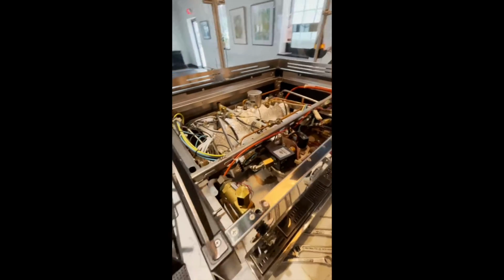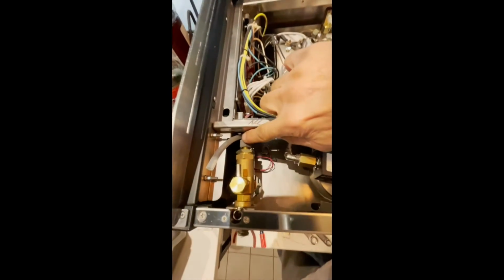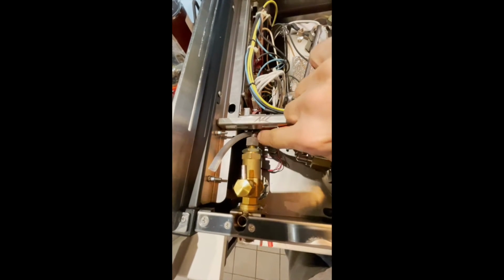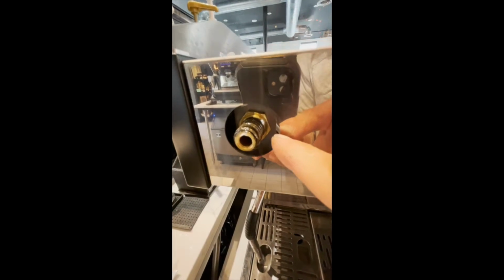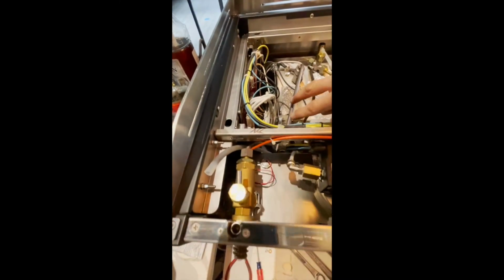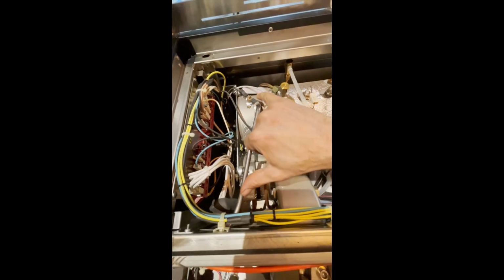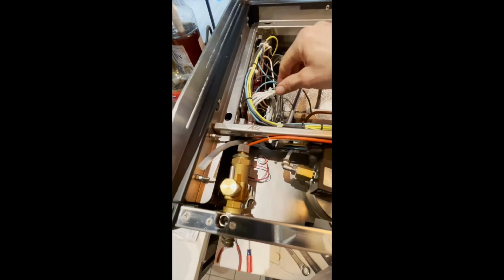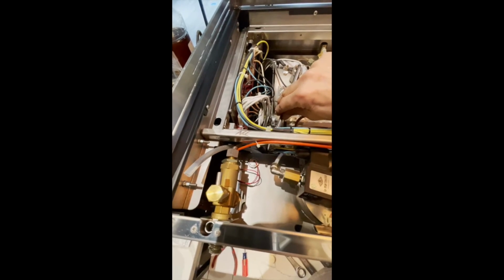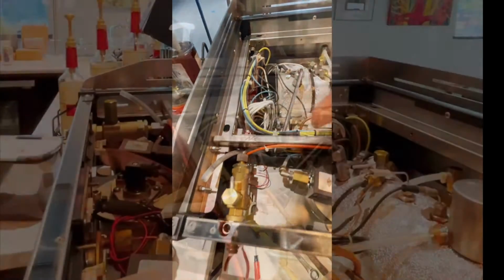And so what we have left at this point is the lock nut that's holding the steam valve body in, and the steam tube that goes back to the steam tank. So we're going to undo this nut here, and the nut that's retaining the body of the valve. But in order to do that, again, we may have to loosen this nut on the back so that this whole steam tube is free to move laterally. Because I found on the other side that when I went to take this nut off, I couldn't unthread it all the way and I wasn't able to bend this tube. It's pretty stiff. And I think rather than damaging the tube, it's better to loosen up both nuts and allow it to slide back on its own.